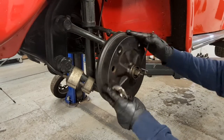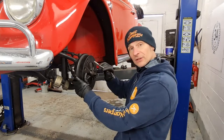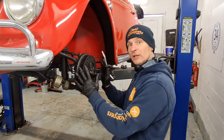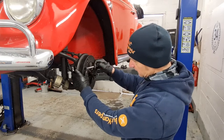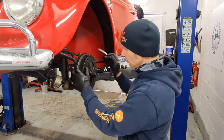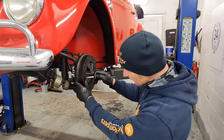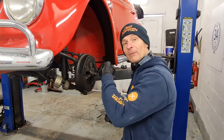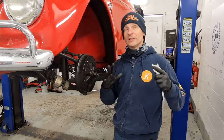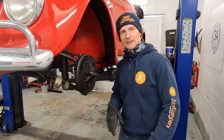Now I can move the drum and adjust our brake shoes. Using the special brake adjuster tool, I'm going to wind the brake adjuster all the way up until it jams the brake shoe against the drum, then back it off a couple of clicks. Do the same for the bottom one. Then I'm going to pump the brake pedal to re-center the brake shoes, and then re-adjust again to get it perfect. That's wound right up and now the shoes are against the drum — two clicks off. Do the same on the bottom — wind it up until it locks, then back off two clicks. Now pump the brake pedal to center those shoes. Make sure you have all drums fitted before pressing the brake pedal — if you press it with one drum off, you'd end up popping a wheel cylinder.